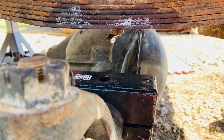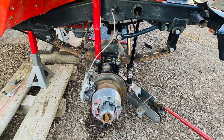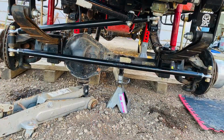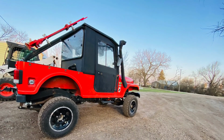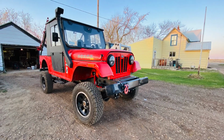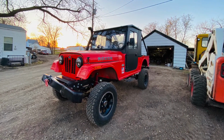And at this point I had one of those bolts on the spring which was too long, so my spring wasn't sitting well on the perch, and I had to cut it like you see in that picture. You have to make sure your spring sits flat and flush on the perch, otherwise something is wrong. Take it apart and find out exactly what's going on.